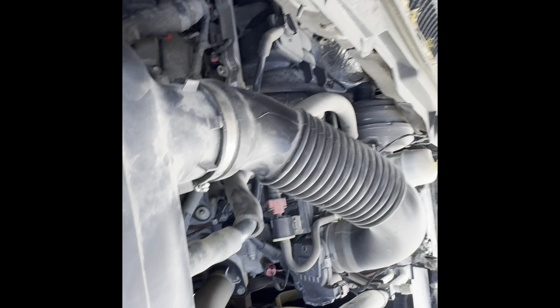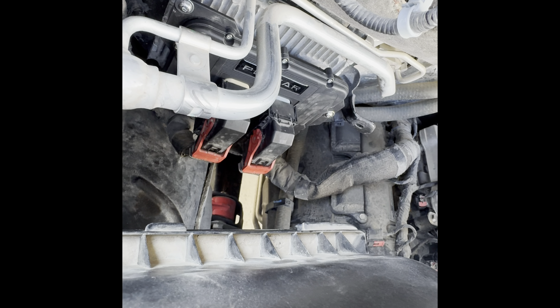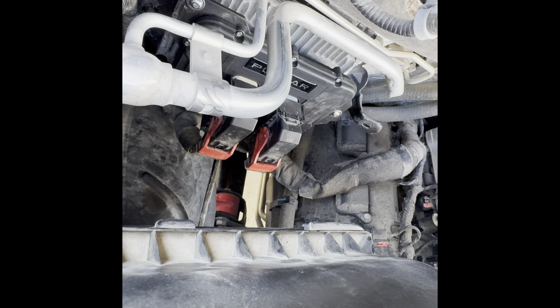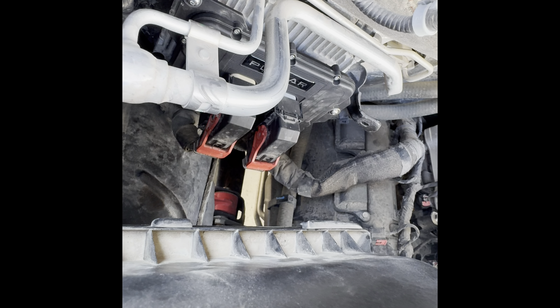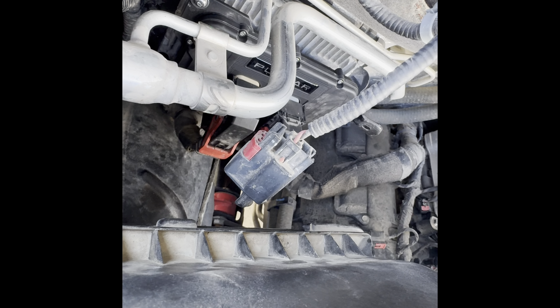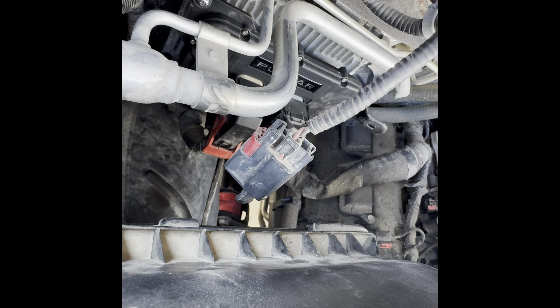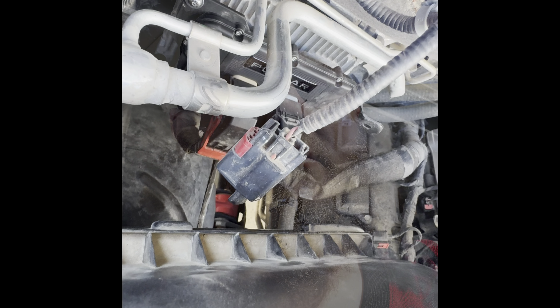Be careful when you do it — this truck's got 115,000 miles on it. This clip down here that holds this arm in — let me see if I can get down in there — the clip that holds this arm broke due to the heat from the motor, because I don't have a heat shield on the motor or the hood anymore. That clip broke, so just be extra careful. I have to take a screwdriver and pop it down in there to make it come undone to get it pulled off.